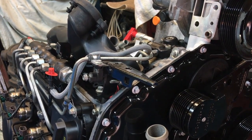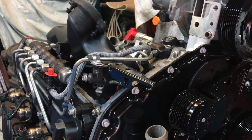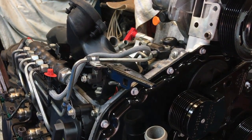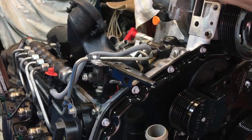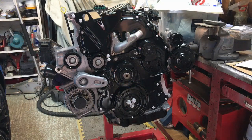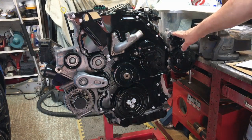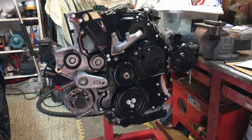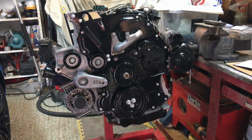They're all down now and they've stopped compressing. 1, 2, 3, 4. Okay, so that's the front of the engine complete, and as you can see now I've got the vacuum pump on. I've used the old gasket and Hylomar because looking online at pictures of gaskets, the original gasket looks better made than any other one I've seen.